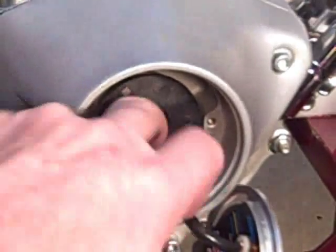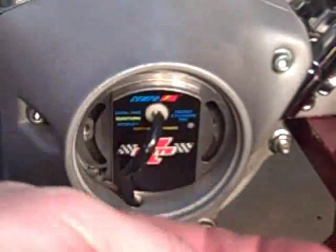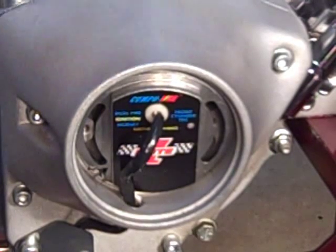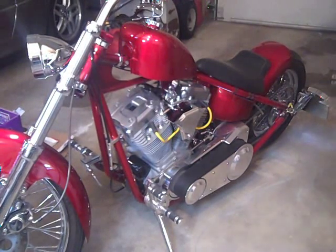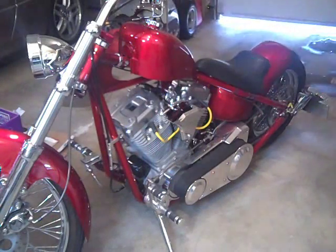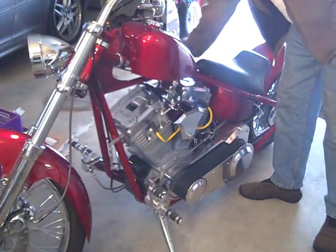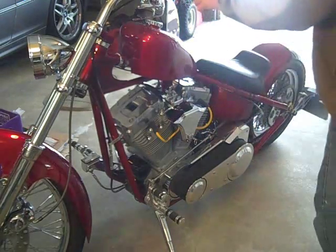Just about to finish this video up. I've installed the rotor and I'm about to install the ignition module. I've scribed two marks in here to line it up, then I'll put the spacer screws back in the cover. I've already turned it over — it's at top dead center. Everything seems to be running smooth. I have to grind the outside of it down; I don't want to scratch the chrome. But it looks like everything is ready to fire up — put the exhaust on and off we go. As you can see it's running. I didn't blow it up. I'd love to take it for a ride, but it's snowing out.